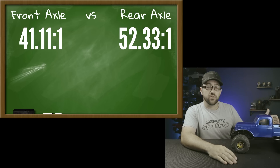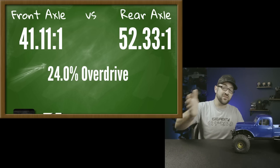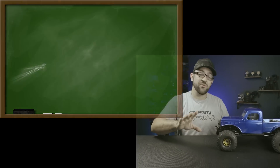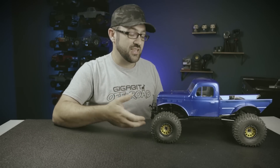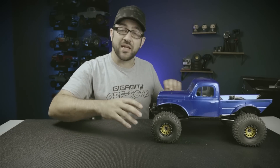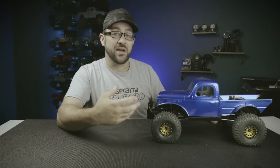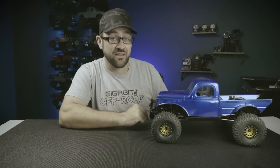The calculated overdrive percentage using both underdrive and overdrive is right at 24%. If you want to learn how to calculate overdrive, check out my previous video where I swapped a portal axle into the rear of my VS410 Pro — I go through all those calculations in detail. That covers how I determined what parts I needed to swap into the 3-gear transmission to run these TRX4 Sport axles. You could skip the math and just buy a bunch of spur and pinion gears and experiment, but a spreadsheet let me figure it all out faster than I could explain it on video, saving me from buying extra parts.